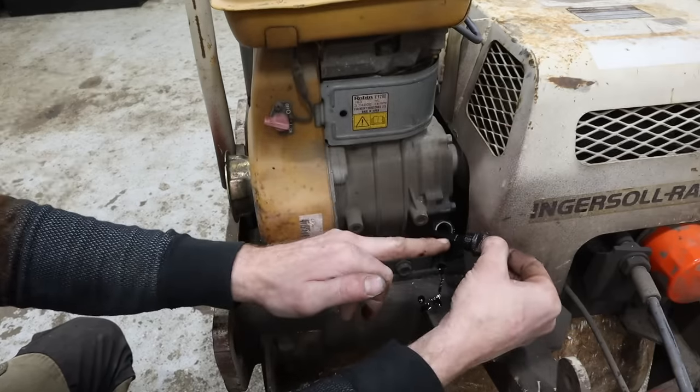So here you can see the oil, hydraulic oil, it's milky, which is usually a sign that water's mixed in. And then you see those droplets there? Those are water. Some of the brown is probably from oil that was already in this thing, but that milky color definitely came out of the machine, so it's actually a really, really good thing that we did this. So I'm happy about it. Plus, I mean, look at that. There's maybe a quart at best of hydraulic fluid in it, so we're not wasting our time doing this.